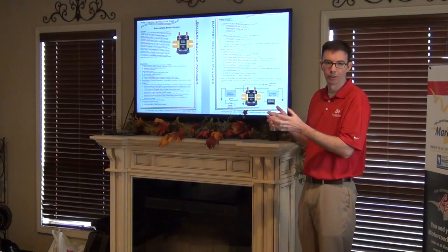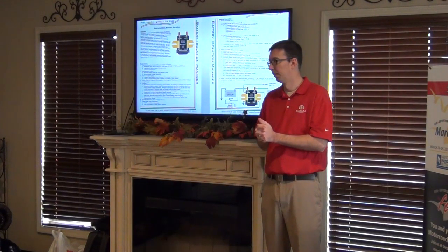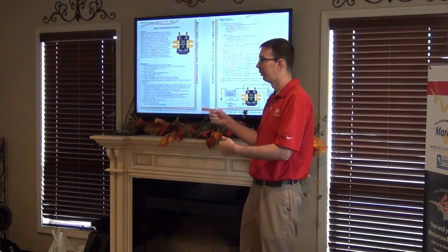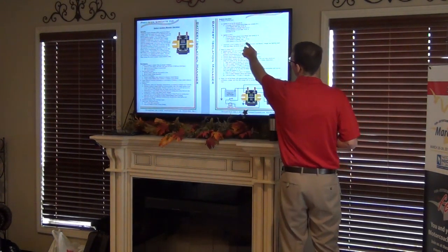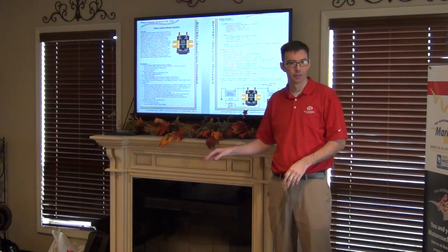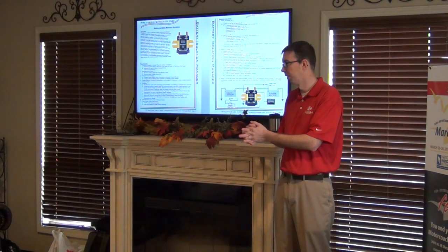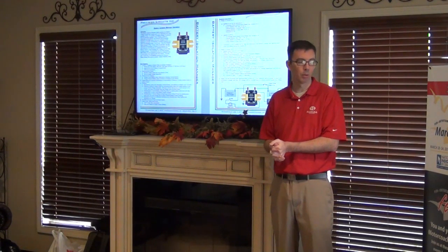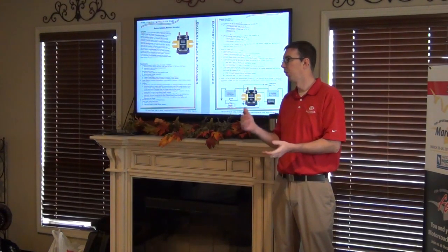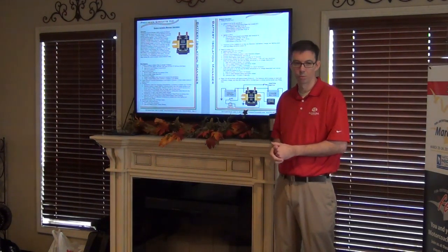This will actually work in reverse when you're parked. Now all we do is swap the voltage — when we're sitting still, I'm looking for 12.6 on the chassis batteries and 13 volts on the house batteries. So if the inverters are charging our batteries all the time, we're staying up into the 13 volts. If your engine batteries start to drop below 12.6, that solenoid is going to connect and charge the chassis batteries back up to their normal state.